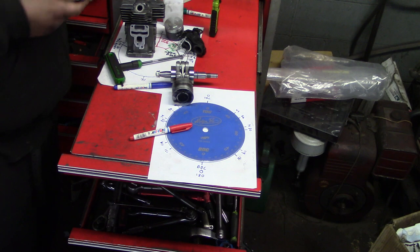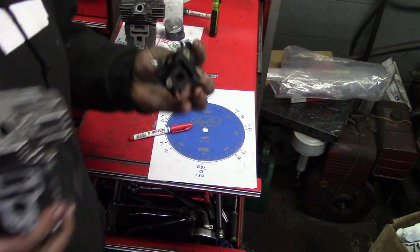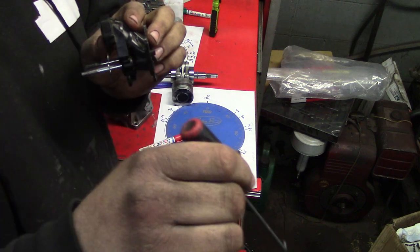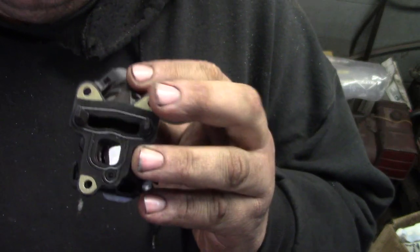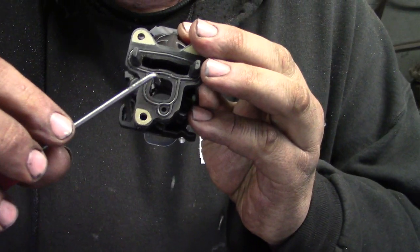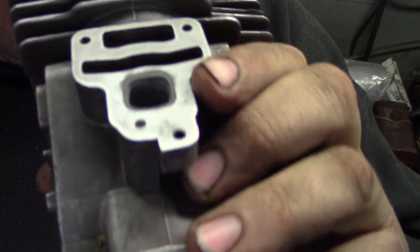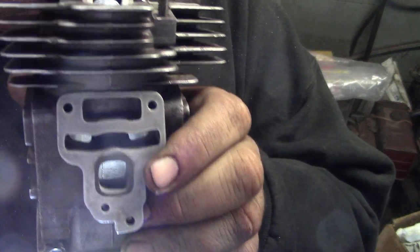Another thing I did to this: this aftermarket cylinder's intake was pretty big — it wasn't matched to my intake boot. It was almost the size of the O-ring or gasket. What happens is when the air was coming in, it was going around the edges instead of going straight in, which was killing some of my velocity. I discovered that if you take your intakes and put a lot of JB Weld, some cylinders you have to match that to your intake boot. There's a lot of JB Weld I put in there — took a lot of time to reshape that, it wasn't easy, almost like doing surgery.